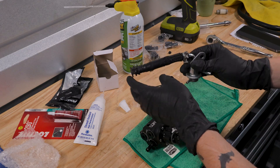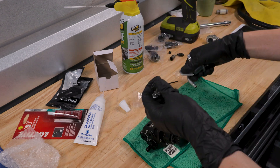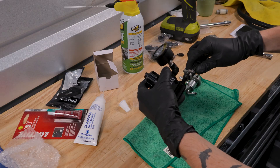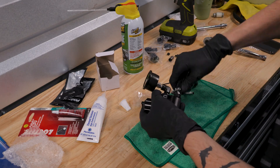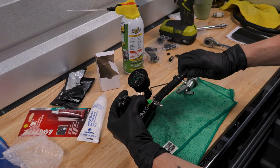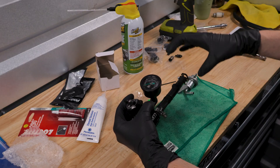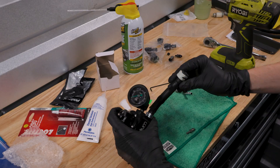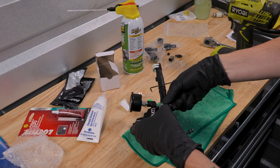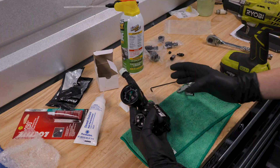I'm going to remove the hose that goes to the return on the firewall off of the Cobb fuel pressure regulator, take this off, then install it on the backside of the radium kit — just like so, squeeze it on, then tighten this down. But before we do, make sure you orient this in the right position. I'm going to grab the white clip and make sure it's going to face in the direction I want. So this is the orientation — I just need to clamp this down. Now we can go to the car and mount everything up.